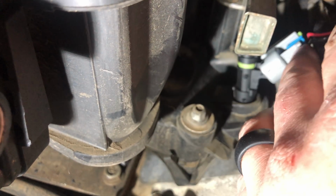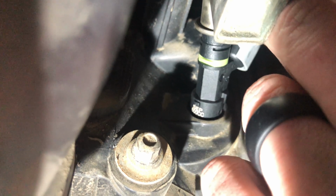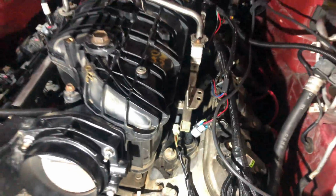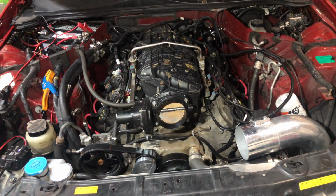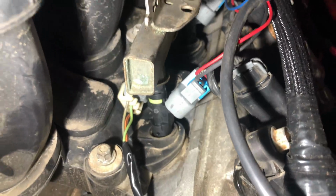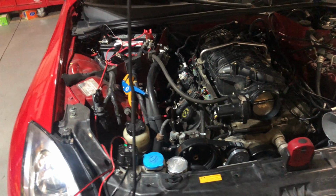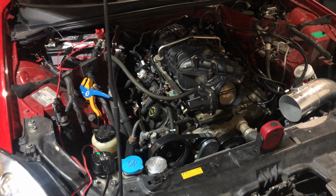For people buying 1500s for lightly modified gas cars. So, SEP 600cc. The 28s weren't going to cut it with this on ethanol or anything else. And luckily enough, this is a Trailblazer intake. His medium height 600s were drop-in, and they had the same connector. You can call it fate or whatever, but honestly, it's the only spare SEPs I had left. I gave most of the other ones away. So I dropped those in.